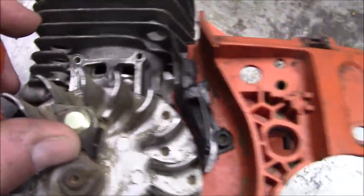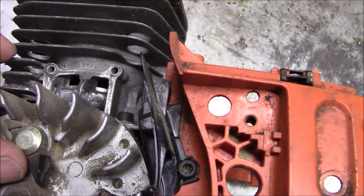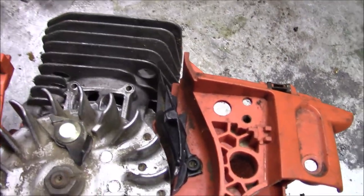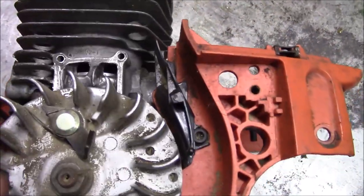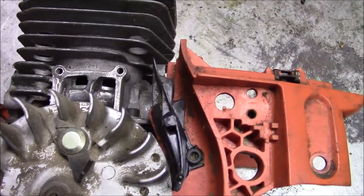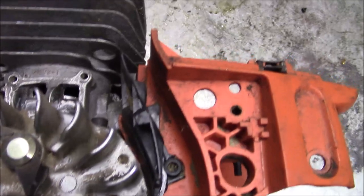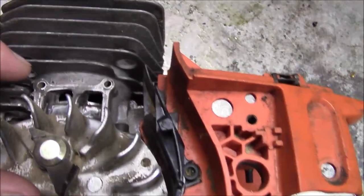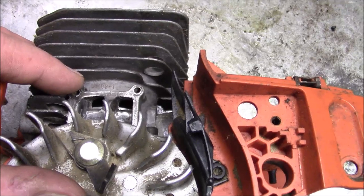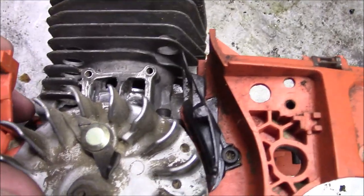And one of the reasons why you get really low blowdown numbers on those builds is because you sometimes have to raise it quite a bit to recover that cross-sectional area. And I know that's a little counterintuitive to the guys who are strictly theory types, because the larger blowdown numbers usually help high RPMs, and the lower blowdown numbers usually help the torque. And with these little piston port engines, after you've dropped those cylinders, you see some very short blowdown numbers because they have to open up the cross-sectional area of the transfers in order to let it flow to the point where it can rev. So what happens is you're gaining more with the increased cross-sectional area of the transfers than you are losing because of the less than optimal timing numbers.